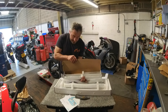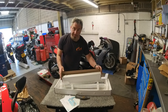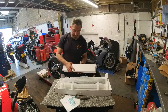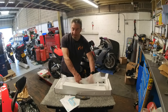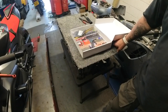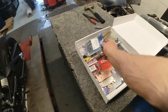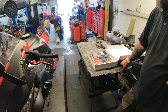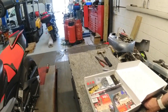The springs match my weight. If you're ever going to buy uprated springs, always do it wearing full gear — leathers, boots, gloves, lid — so you want your total weight as you would be riding around. I've got track pads in there, so racing pads. I'm leaving it as standard gearing on this — being a twin, it doesn't rev as high as a four, but it's got plenty of torque, so the standard gearing on this is pretty good.